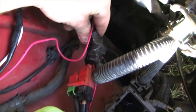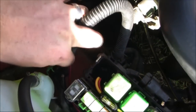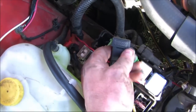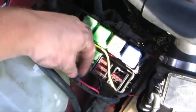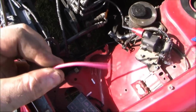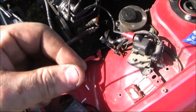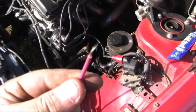My battery cable comes from the back of my car all the way up here. Right here's the wire that I've attached straight from my positive battery cable — it just has a 30 amp fuse right there. You're going to need either 14 gauge wire probably; it recommends 12 but I think 14 would be sufficient. You're going to need a wire coming straight from a 12 volt source such as your battery cable.